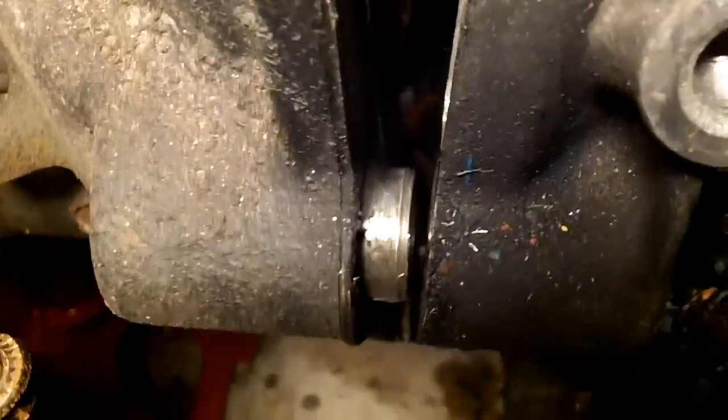I can't really see how far that shaft goes, or actually I can't even see the shaft. I can see that drive plate separated pretty cleanly so far. About the only thing I'm really worried about right now is that axle and these dowel pins. I do not want to mess up these dowel pins, because with my engine rebuild, you mess up a dowel pin, you're gonna have a bad day. In order to drop it so those dowel pins don't get real marred, might need 2 jacks.